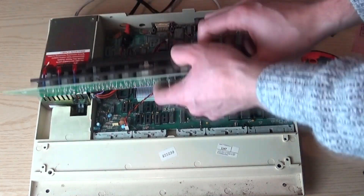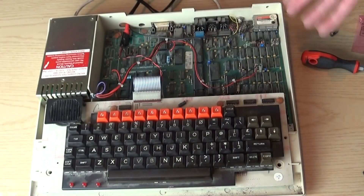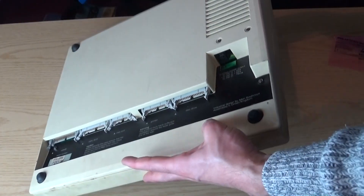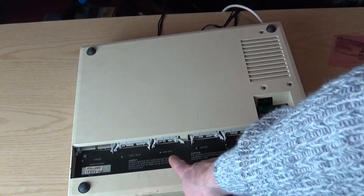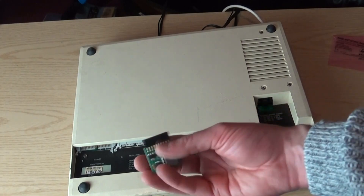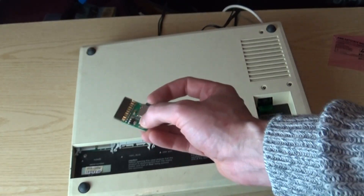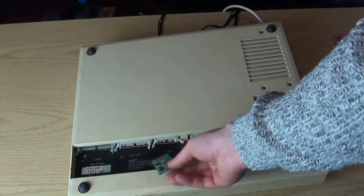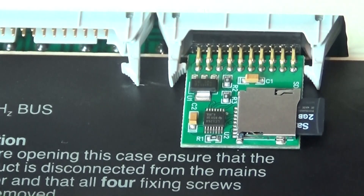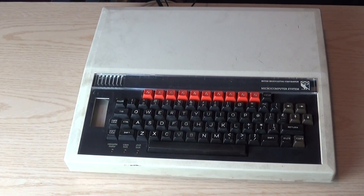It's just a matter of carefully putting the keyboard back down, putting your screws back in either side of the keyboard, and putting everything back together. Once you've got it all back together, turn it upside down. This device goes into the user port — the third one across — and it has to be facing this side up. If you can see the memory card sticking out to the right, that means it's in the right way. So it goes straight into the user port. And there we go. Now it's all done for the hardware side.